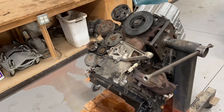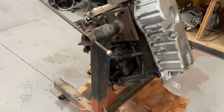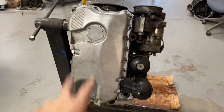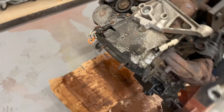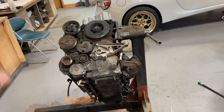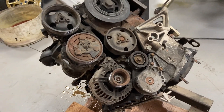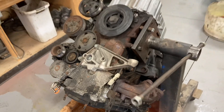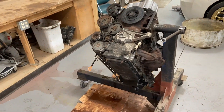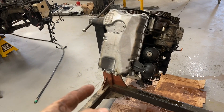So as you know this engine was knocking. Look at how this thing mounts on the engine stand — it's all the way off to one side, so when you pull that pin it just wants to almost take your arm off. First things first, I want to take this oil pan off, get the bottom off and see what that looks like, and then we're gonna pop the head off. I'm hoping I can get away with some bearings, a couple little parts here and there, a new head gasket, and keep the head assembled — as few pieces as possible. It's extremely heavy because it's completely off-center, but it is what it is. Just have to have help rotating it. I'm gonna clean this up and then probably make another mess.